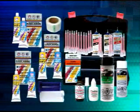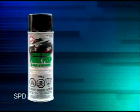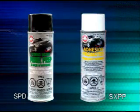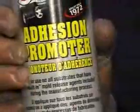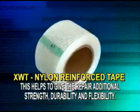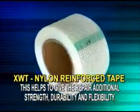Before we get started, let's review the products in this grouping that we may use in the repair. SPD, citrus-based panel prep, a great cleaner for both plastic and metal parts. SXPP, our wonderful adhesion promoter. This product is for use on all flexible or semi-rigid plastics. Dominion SureSeal Adhesion Promoter is for use on bare plastic bumpers before you apply your repair materials or automotive paint. XWT is our nylon reinforced tape. This helps to give the repair additional strength, durability, and flexibility.